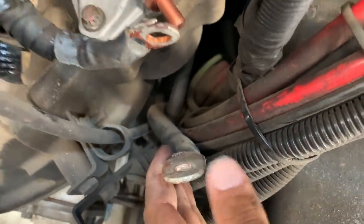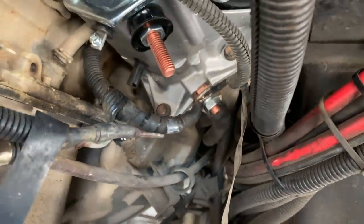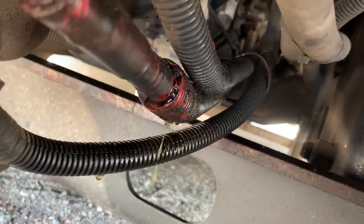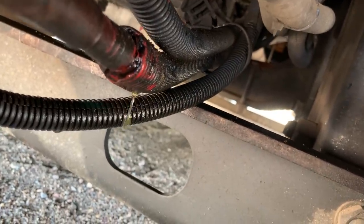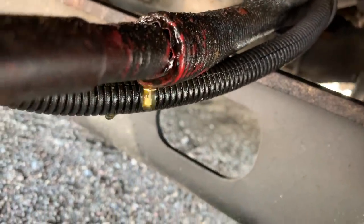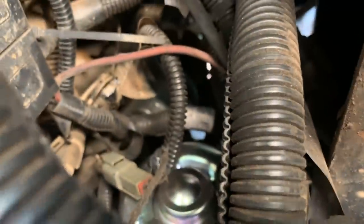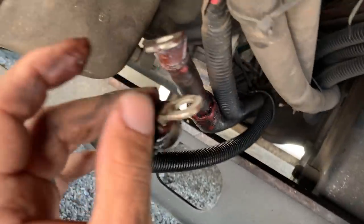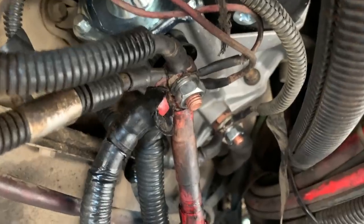Taking off the nuts and getting the wires hooked back up, but first I'm going to file on these just a little bit — they're not too bad but the cleaner the better. Interesting thing to note as I'm hooking up my wires here: I'm getting the positive wires and they're leaking fluid. Pretty sure wires aren't supposed to leak fluid. It smells like varnish — must be really old diesel. I'm wondering if when you don't change the fuel filter, which is above the starter for some reason, the fuel drains down here when you pull the filter out, gets in this wire loom, and just sits there. That seems bad.